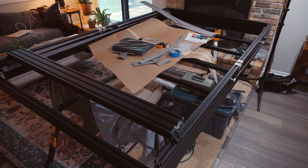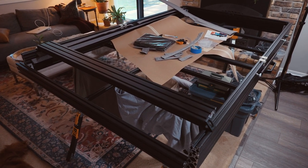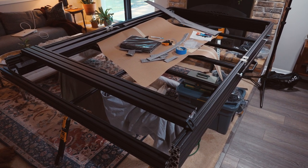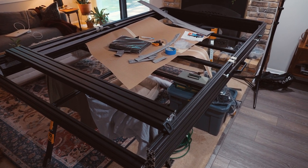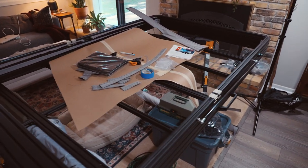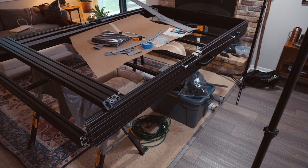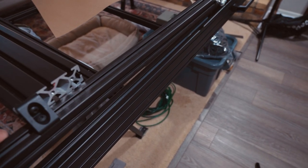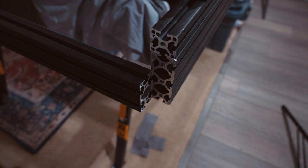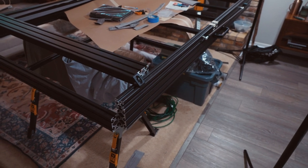This is probably the most exciting project I've had going on — it's a DIY rooftop tent. I started it back in January and have been slowly working on it on and off. The outside of the tent shell is built out of one-and-a-half-inch aluminum extrusions: the top is a 1.5 by 1.5 inch extrusion, the bottom is 4.5 by 1.5 inch. I went with these dimensions because I wanted to use a four-inch X-Ped mattress.